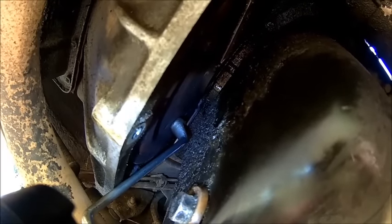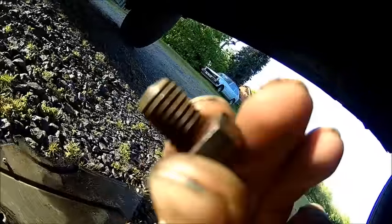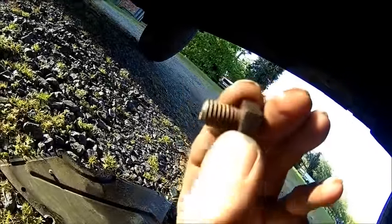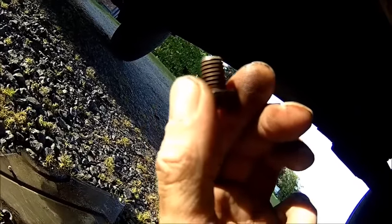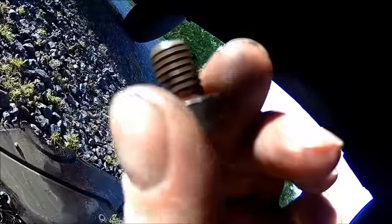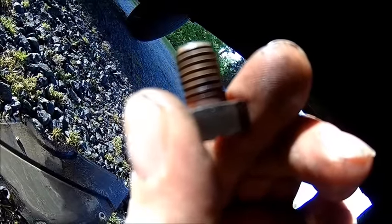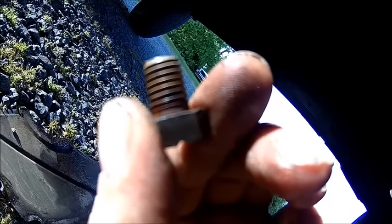I'll turn that around and take it out and have another shot. That's where the bolt sits, and that's the bolt — it looks good actually. You can only see a bit of fretting on the surface. The thread is fine; it didn't come out far. So we'll give that a little clean, put some loctite on, put it back in and check the others. The first one was tight, just this one. There are four in total — they're 15mm, or maybe something imperial, but a 15mm spanner fits.